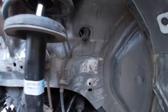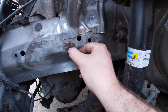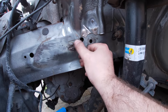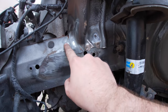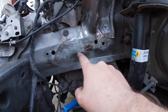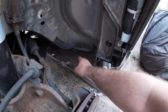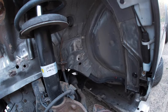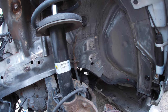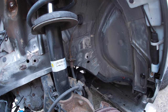We've finished getting all the little rust spots down to bare metal. There's something here that looks like a weld - it's pretty strong, I've tried getting the screwdriver in it but it just won't budge. I'll put some rust treatment on there as well. I went a bit further up than I wanted, but there's rust there anyway so I may as well just mask from there and paint the whole thing with underseal. I'll get the rust treatment out - it kills the rust - let that sit for an hour, then prime, then underseal.